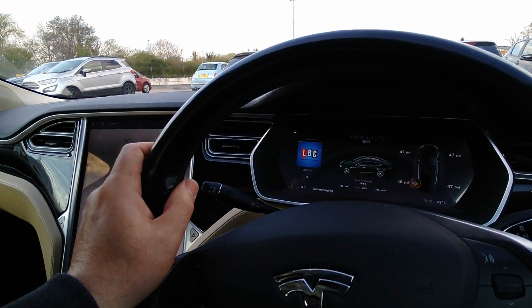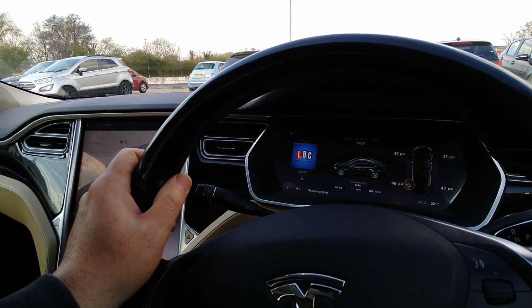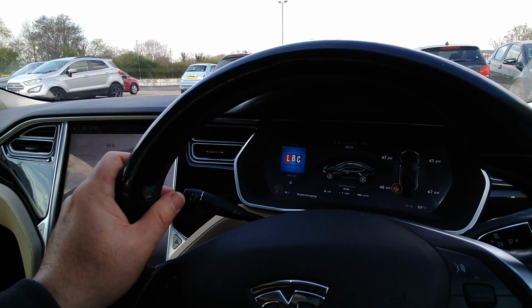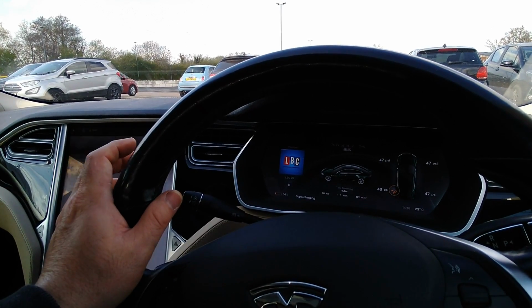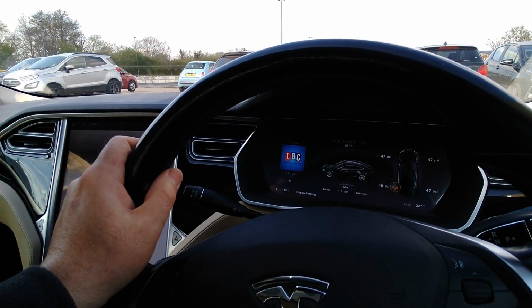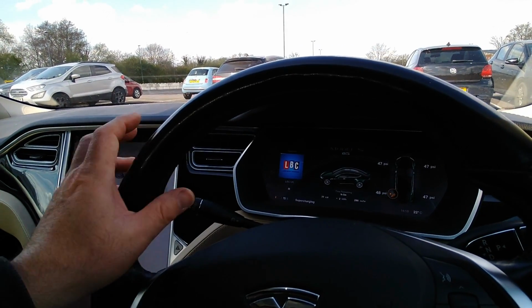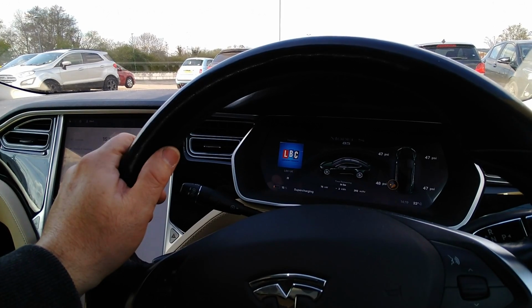So unfortunately I've had to leave the customer and their mirror is still not working. I really thought it was a 12-volt battery, and in their case the battery was only measuring 5 volts, so that was clearly the first issue. But using another 12-volt battery with my jump leads, that was no better. Then I realised that there was this issue with the lock on the charge port and fixed that, and really thought that was then the issue, and that didn't help either. So I've left him with his 12-volt battery on charge, and I've left my battery charger with him, because even though I was trying to charge that battery, it still wasn't charged up enough and good enough to put back in the vehicle. So I've lent him my charger, and he can continue charging that battery overnight.